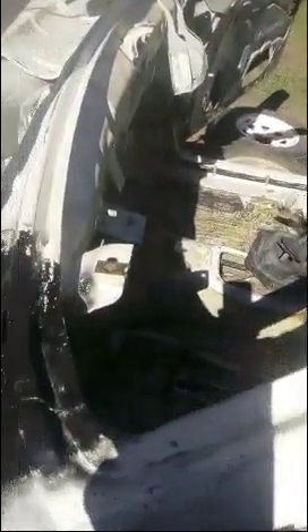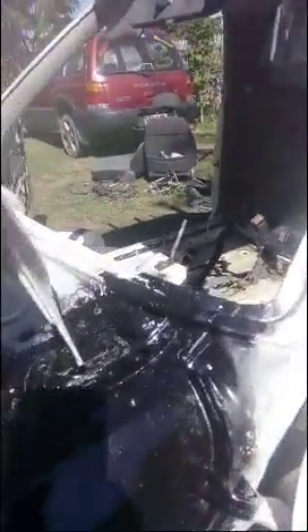All of the seam sealant — I've scraped most of this off — I've given it a bit of a sandblast and cold galvanized it with a paint that contains about 98% zinc. So this side is extremely good. If you can find a car that has no rust in the windscreen area, definitely look to pick that up, or at least you can chop this part out and weld it back into another car. This is probably the most frequent spot and absolutely one of the worst.